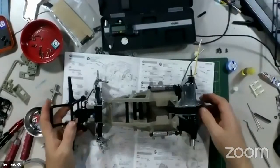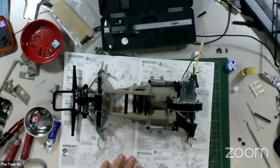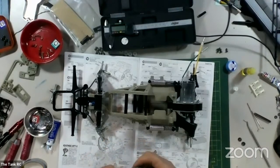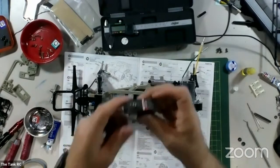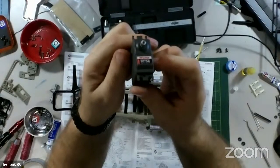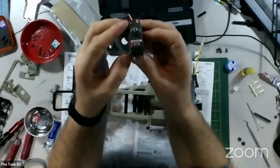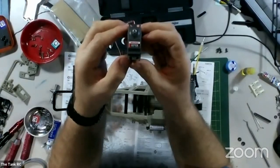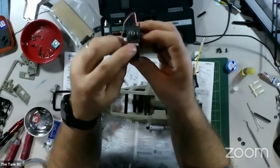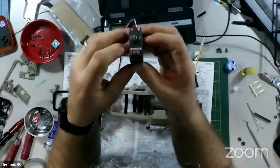Yeah, if say I'm racing on road, I'll set everything on my suspension as far as my alignments. Everything will be at 2 degrees positive on the rear. It'll be 2 degrees negative for the toe. And then I'll put a 40 weight oil in the back, a 30 weight oil in the front with a stiff spring in the rear and a medium weight spring in the front.